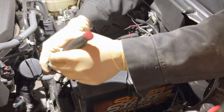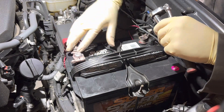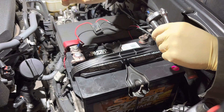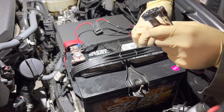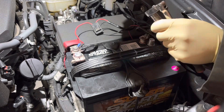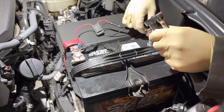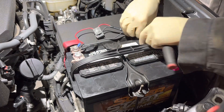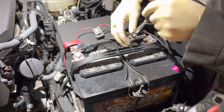We'll get these terminals snugged down. An important thing to remember is you want to get them fully fitted — these terminals have a cone shape, so they're a little skinnier at the top and a little wider at the base. Make sure once you get the caps off — and I have seen people leave these on before, which is a big problem — you take the terminal and really wiggle it down. You'll end up getting a little bit of extra throw onto that terminal.